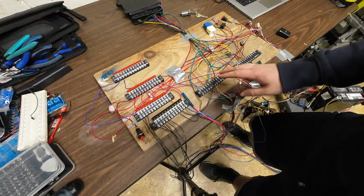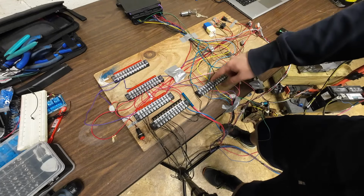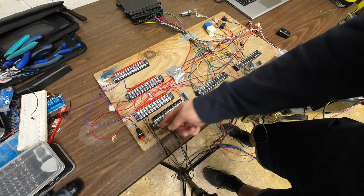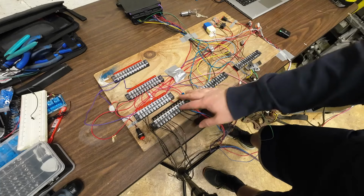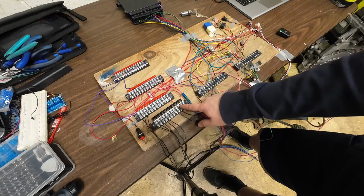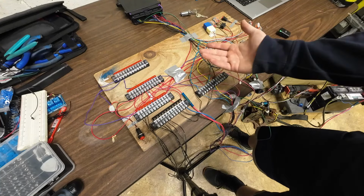Now it really confused me because these 3 wires that are labeled in the diagram for the Zombieverter are color coded so you know which one goes to the Zombieverter. Yet the ones that are all the same are the positive, which are black. So that's why our contactors weren't originally tripping: we were giving it a ground on the positive and a ground on the negative side, which obviously won't power a contactor.